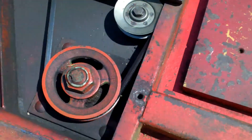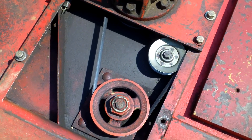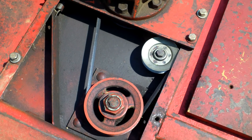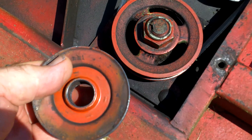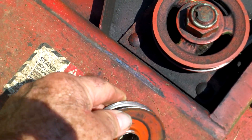The tensioner pulley inside that silver one goes bad and you don't know it because it's got a cover on it. Instead of the balls coming out of it, it turns into this right here — this one falls out and you just have this. This ran for six months that way.